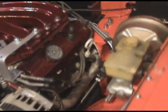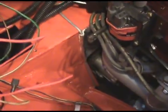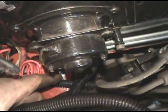The new brake line's been routed — they run up across the firewall, across the back, and disappear down the sidewall. I really got lucky; I only got one hose here. I put a little heat shield just to make sure, because that's my brake line. Everything else is running way down deep inside there. As it curls down and goes past the transmission, everything clears.